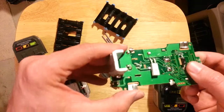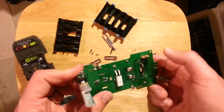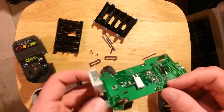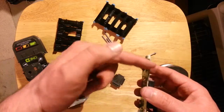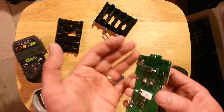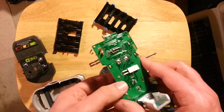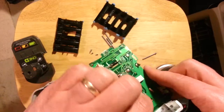You can see on this edge and over here again there are these pieces of metal. Just like inside a laptop battery pack, all of these are tack-welded pieces of metal that actually envelop the entire side of the battery pack. So you have an entire row of five and another row of five — everything is tack-welded onto these connectors, putting the batteries into two series of five and then into a parallel set of two. So it's 5S2P, as I've come to learn from doing a lot of reading about these configurations.